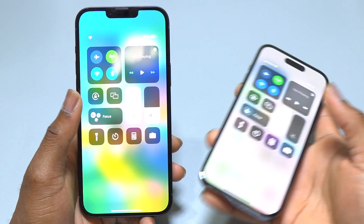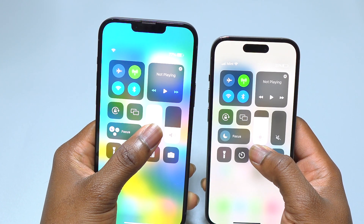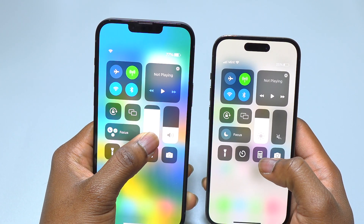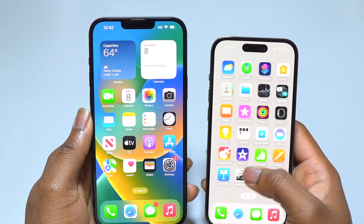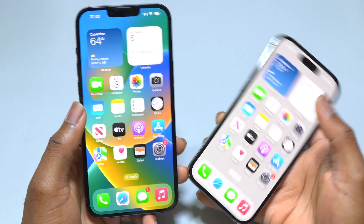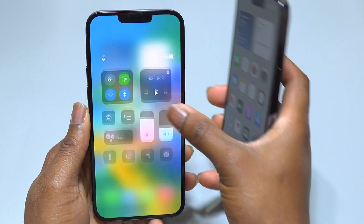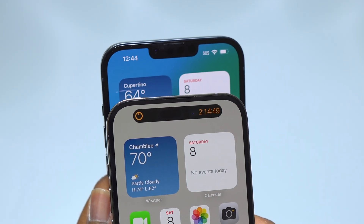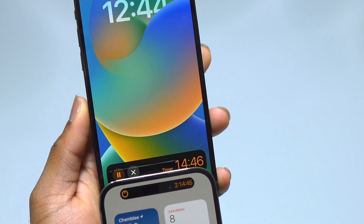When the screen was off the device, Face ID was working properly and I didn't have any problems. So for this iPhone 14 screen, I'm going to return this one and get another screen for about $35 and have that installed on this iPhone 14. The process is the same regardless of the screen that you get, and you should not have any issues pertaining to Face ID and any other software lock for this iPhone 14.